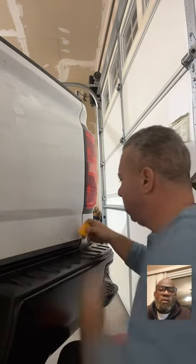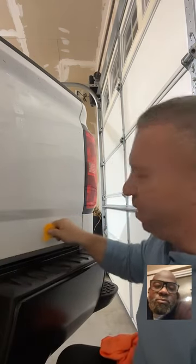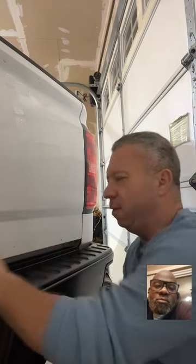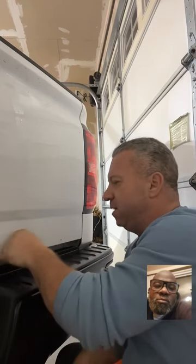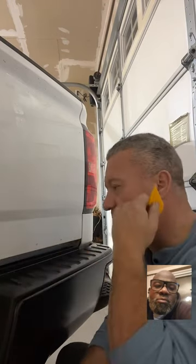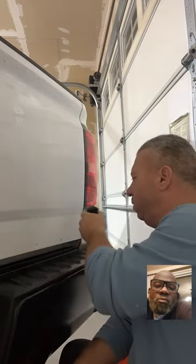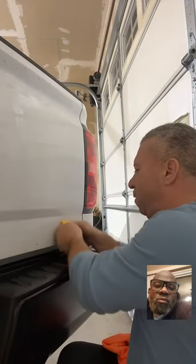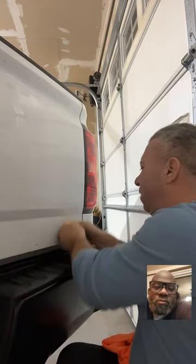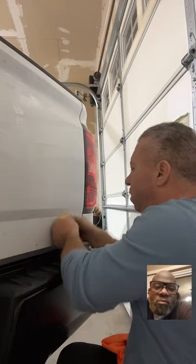One of the things we're talking about doing is offering a $10,000 detail where the whole car is cleaned with dry ice. Literally every inch of the car except for the leather will be cleaned with dry ice. The benefit is that it's not abrasive, but it takes everything down to original, like the tires. And then obviously offering up to a 5-step paint correction: a 1500, 2000, 3000 wet sand, and then a rotary cut and polish. So that's the 5 steps. Then obviously a full interior, and then a 5-year coating on the car.